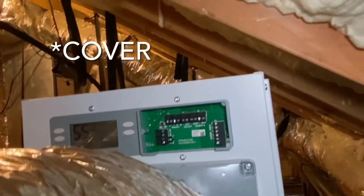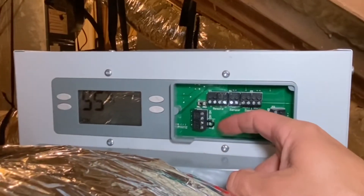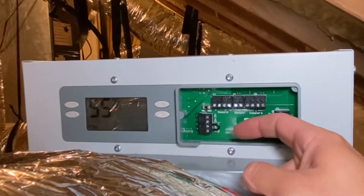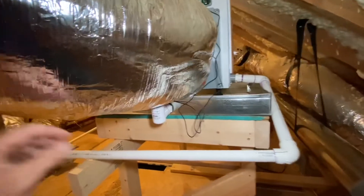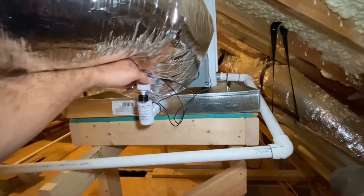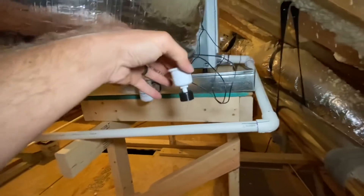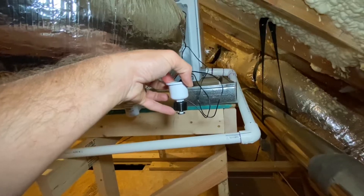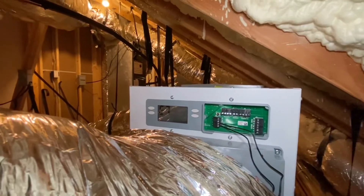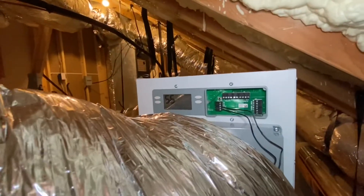I took this little control panel off right here, right off the front. Right now there's a little jumper switch right here. I'm going to read the directions — I think I just pull that jumper switch out and then wire that switch right into there. I've got my float switch in there; I've got it wired up. I just turned the unit back on to test this float switch. As water fills that thing up, this should float up. Okay, it works — it just turned the unit off. It says E7, probably error seven. I'm going to release it. Okay, and now it's back on. So that's awesome.